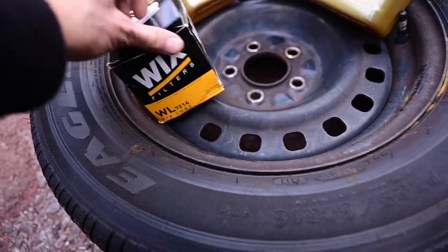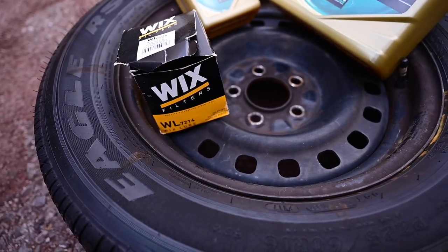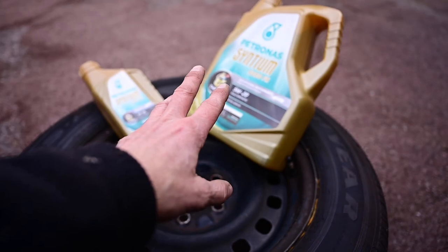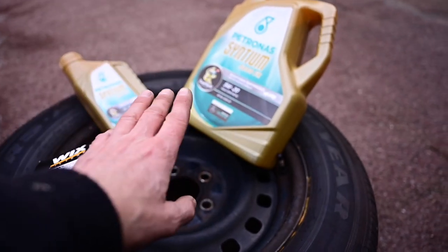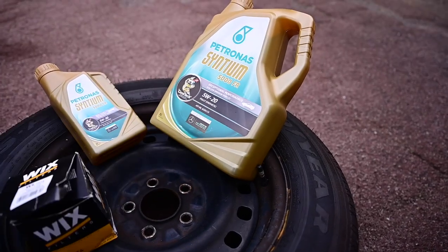They had it within about two hours instead of mail-ordering a Motorcraft from the other side of the Atlantic. I'll get a stockpile of them before too long. Checked all the book and everything, and it says 5W20 fully synthetic. Checked all the forums as well and they all agree. Some people say 5W30, but 5W20 seems to be the one to go for.